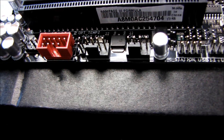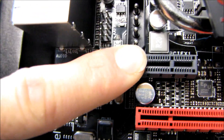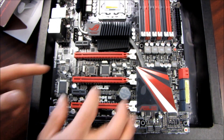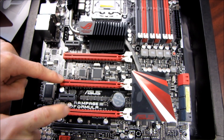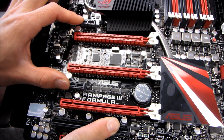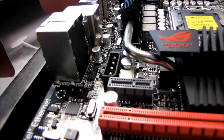Let's look at the PCI Express layout. There's the Supreme FX X-Fi 2. We start with a PCIe 1x slot at the top, then a PCIe 16x slot. Note there's an absence of a slot after it — the assumption is that if you're buying an ROG board you're probably using a dual-slot graphics card, so you don't need one there. Then we have another PCIe 16x slot, a PCIe 1x, another 16x, and a PCI slot. Running dual-card SLI or Crossfire uses the two 16x slots, which leaves two PCIe 1x slots still usable. There's also an auxiliary Molex power connector — if you're running up to three cards you should plug that in, otherwise you're drawing too much power out of the 24-pin connector.